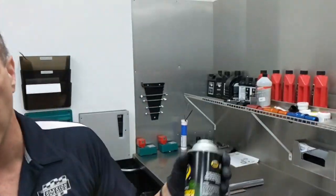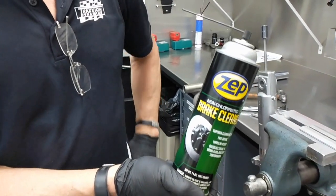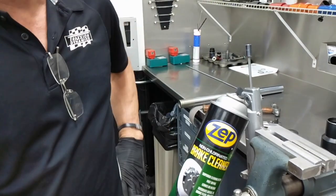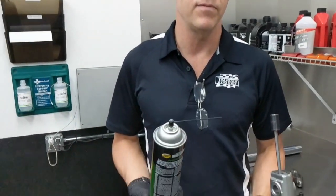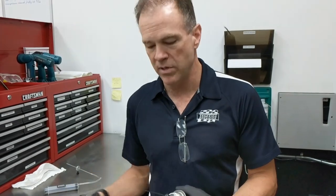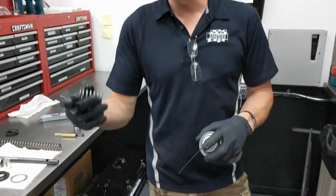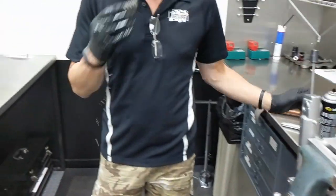It's a good product you can find in a lot of automotive stores — it says brake cleaner on it, but this is really like electrical contact cleaner. Brake cleaner is kind of nasty and caustic to work around. If you can find electrical contact cleaner, that's really the best stuff for doing this job. You'll always want to spray all the parts down completely clean because they are dealing with damping units here. This cleaner evaporates instantly and leaves no residue.